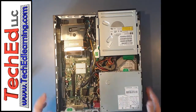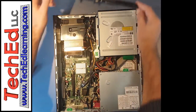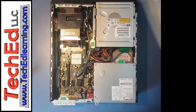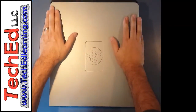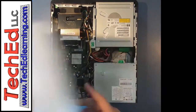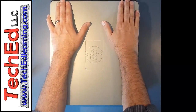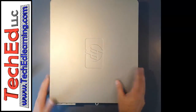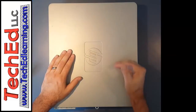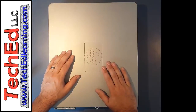That snaps down. We can put our cover on now — there are little hooks on the end that slide in. That hooks on, and then you can put your cover back on. There are little hooks that slide into slots here, so you have to have all of them lined up at the same time — that can sometimes be tricky. Put your hands and forearms down on it to make sure it's flat, then they lock in. Push it forward and it locks. You can see it's all lined back up and back together again. For this project, you can watch this video in steps — only one or two minutes at a time, pause it, take yours apart, and then put it back together again. Good luck with the project!